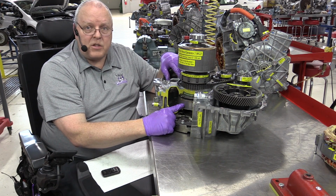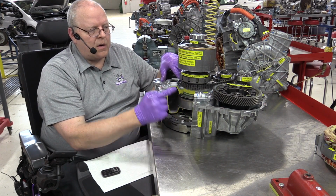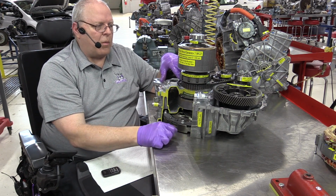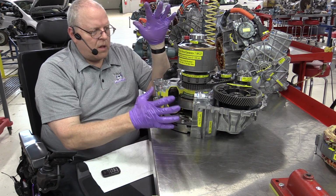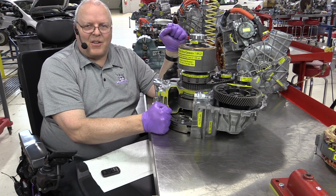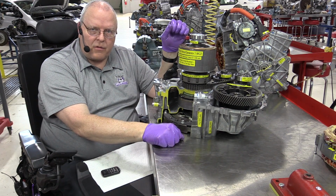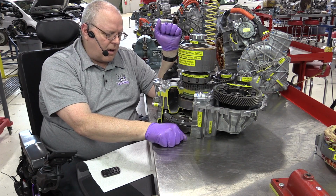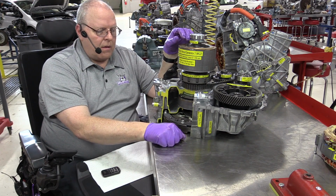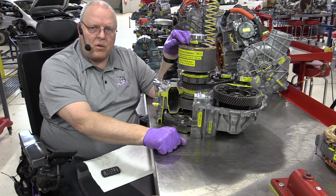If we need to really generate some power, we can crank the engine speed higher or lower depending on the rotational speed of MG2 to get the power that we need to move the vehicle down the road. They really did a lot to make sure that you did not go into the turtle mode. The first generation Prius had a turtle mode where a dash light of a turtle would come on that would indicate that you were out of battery power and that it was all the engine turning MG1 could do to generate power to run MG2.